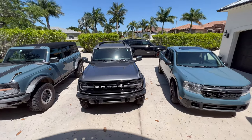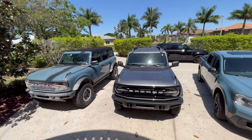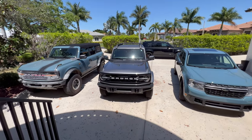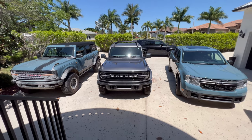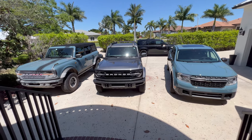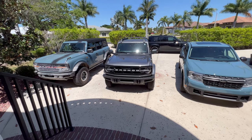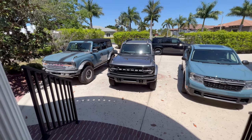And for you guys that are in super warm environments, like right now, before I install this, I am going to flip this vehicle around. I'm going to put that fuel cover on the opposite side, on the shady side, because I want to be able to control any additional amounts of heat. The longer I play with that material in this sun, the more stretchy it'll become. And that soapy water that we're going to use during the install is going to dry right out. So I'd rather have a little bit more water than desired during the install, and then I'll add heat and let it dry out, and I'll keep on watching it through that process. If the sun dries it out too quickly, it's really hard to reinstall or just to get that install correct the first time. So let me grab everything we need to do, flip that vehicle around, and we'll meet back right here.